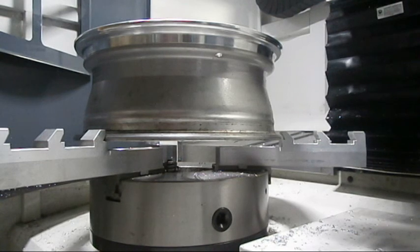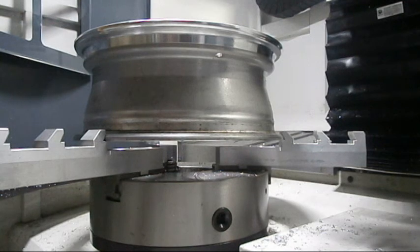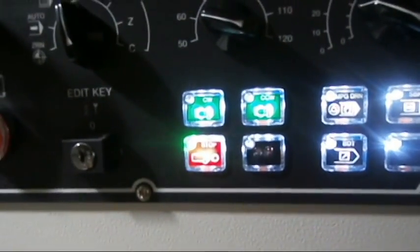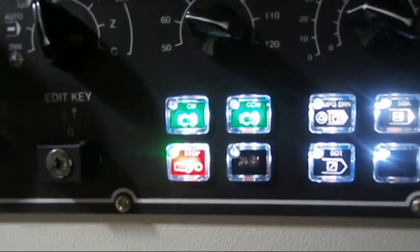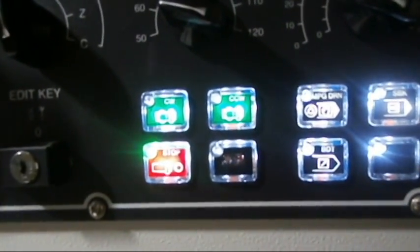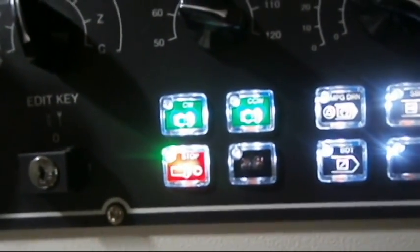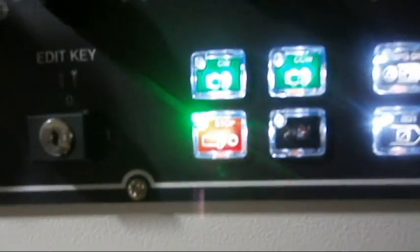After installing the rim, one should always make sure that the rim is in balance. In order to do so, the machine has two buttons — clockwise and counterclockwise. These two buttons allow you to rotate the spindle in either direction. Please be aware that there are going to be moving parts when pressing this button. Please keep your hands, fingers, and any loose parts out of the frame.